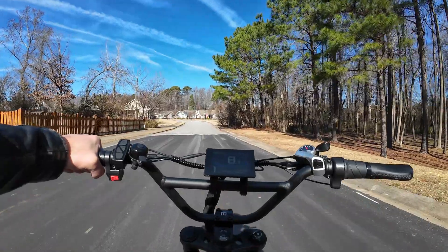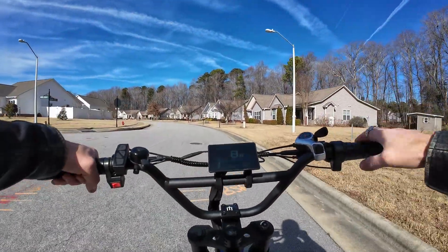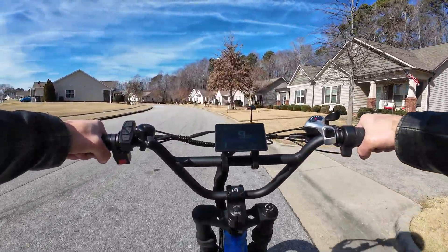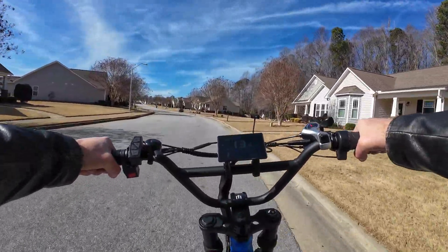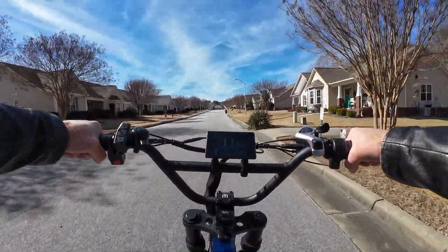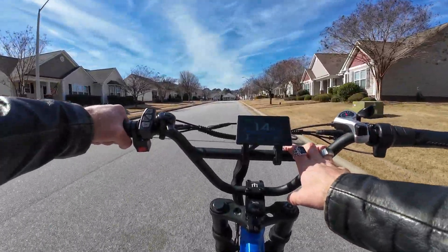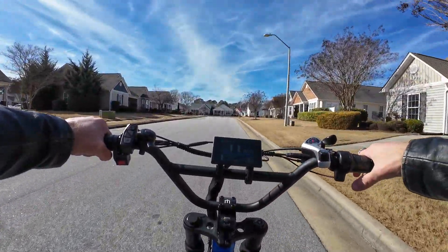So you just go in, select the class you want, and the bike automatically sets the parameters. For now I'm digging the slow start feature - that is very helpful. Putting the front motor on slow start, and being able to adjust the power in each wheel, is probably going to be helpful for off-road stuff too. I was complaining before that I had to tune everything down to get the front wheel spin under control - now I can leave the back at 100 and put the front at 10 power for much better off-road control. This is a much-needed update. This is not the final version - they're still tweaking it. Wired told me they're going to find a way to make it available for existing Predator owners - you'll probably have to buy a programmer and they'll send you the software.